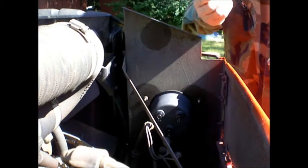So what you should do is coat the outside of this bulkhead connector, not so much for sealing against the weather as for keeping it somewhat lubricated, so that the outside of the connector doesn't stick and weld itself to that, with more of a chance that it won't. And when I say a little bit, you literally put a little bit on your finger and rub it around. You can probably use the same little dab on all three connectors, just enough so you can feel that there's some on there.